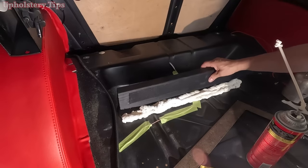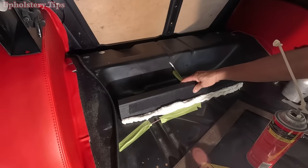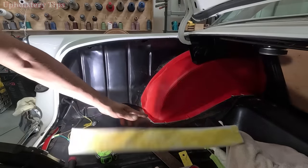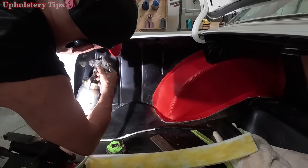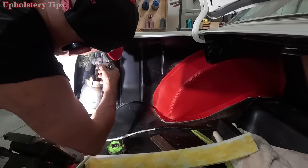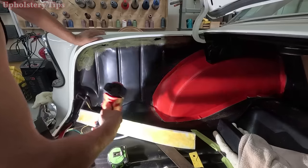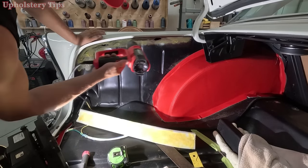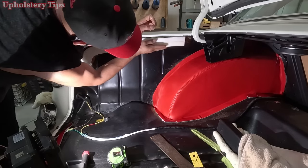If you've been watching my English or Spanish channel — where I have more than a thousand videos — you've seen me using expandable foam a lot. Right here there's nothing to hold the panel I'm going to put on there, so I get a 3.5-density foam, cut it two-by-two, tape it up, put glue on it, activate the glue with hot air, and glue that foam on there.